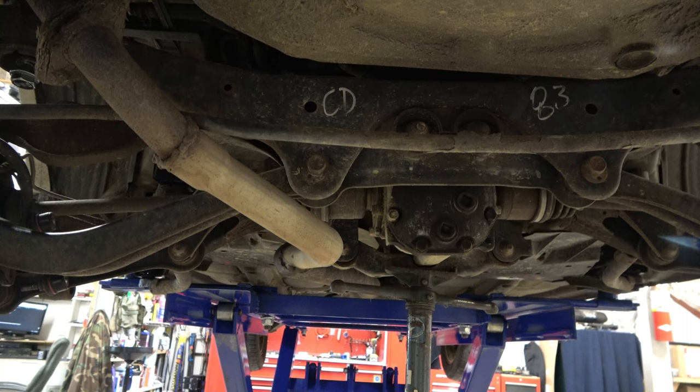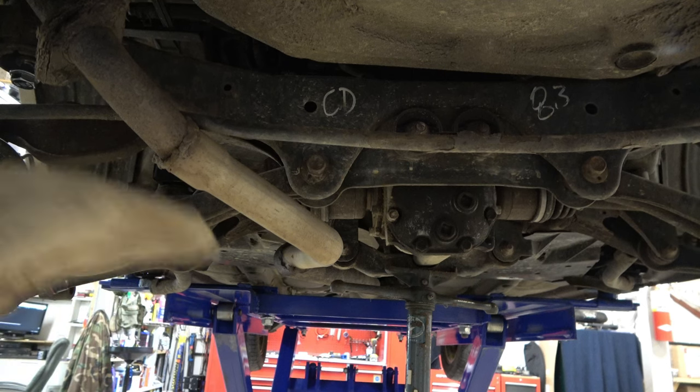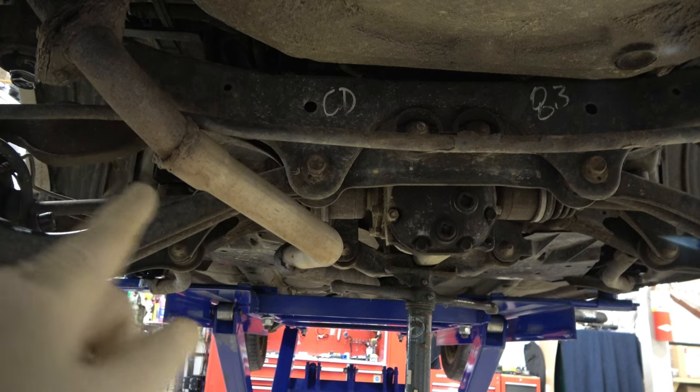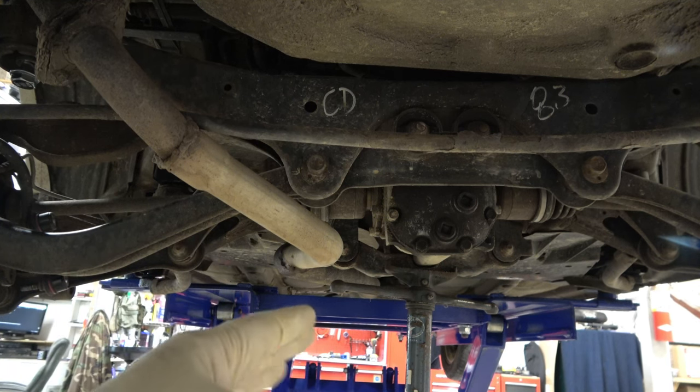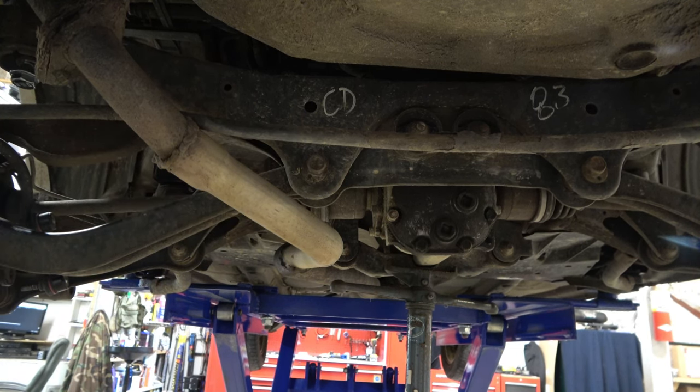I would recommend you loosen the bolts — and there's a lot of threaded bolt that goes up into the frame of the car, at least that much. So all four of them I lowered down about this much, then I went ahead and lowered this side, took this side all the way out once I had supported it. With just a pry bar I was able to pry down just a little bit and slide those blocks into place. You can see the block, and there's actually quite a bit of gap still in it. I never was at risk at any time of the whole cradle coming out.